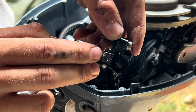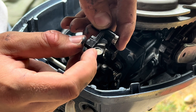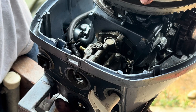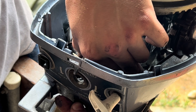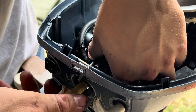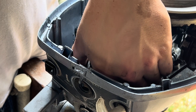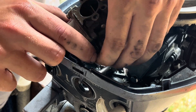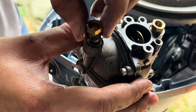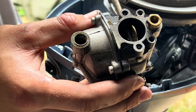One thing on this four horse model — you want to make sure this little plastic piece is not worn too badly. Mine's got a little groove, but if they're any worse I'd recommend replacing it because that'll mess up your whole timing. Now we can remove the other 7/16 inch nut. You'll also have to unscrew your high speed adjustment needle — it'll just loosen by hand — and looks like you'll have to remove the slow speed as well. Now the carburetor should be able to pull right out.